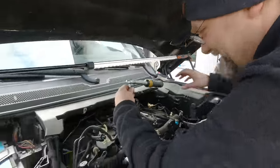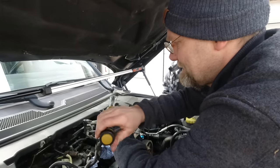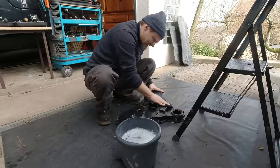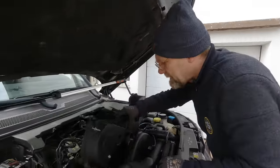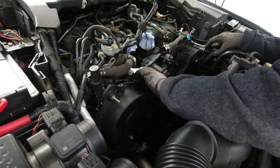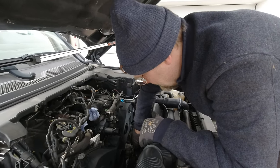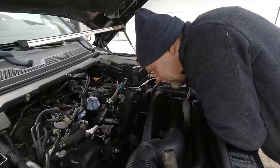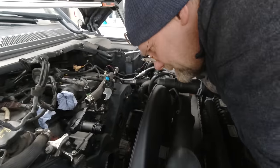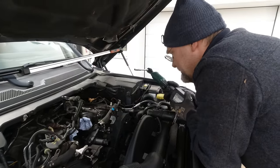Dad showed up — he's 84, he's going to help me putting that timing belt back in. 11 newton meters. So this goes back in and I try not to screw this up. 16 bolts to 10 newton meters — one, 10, 16. Oh, I can't believe it. We screwed up again — we forgot to mount the idler here. So all 16 bolts have to come undone again.